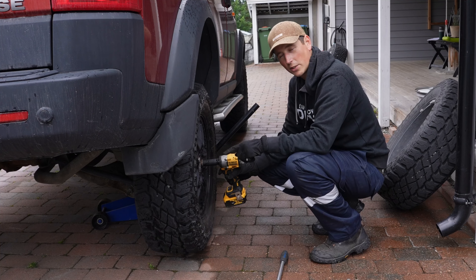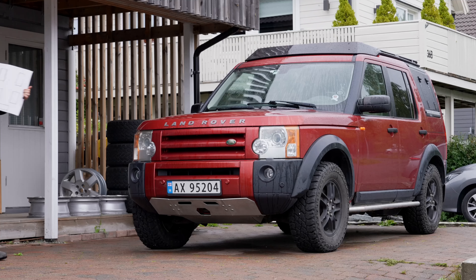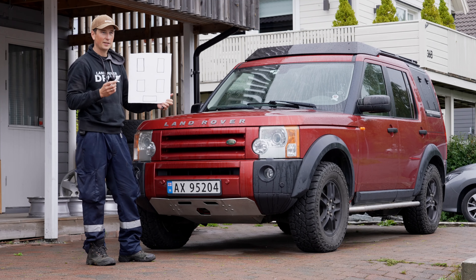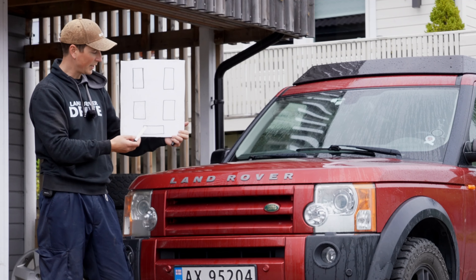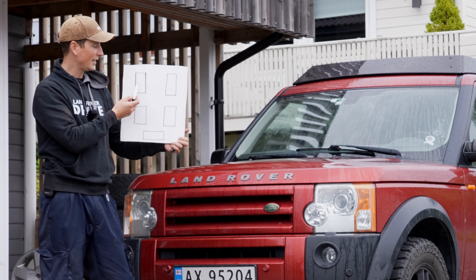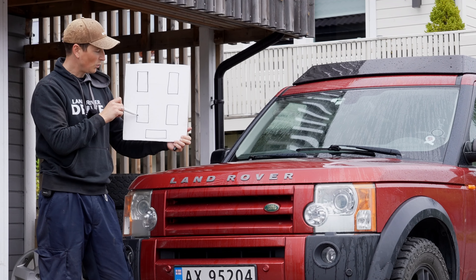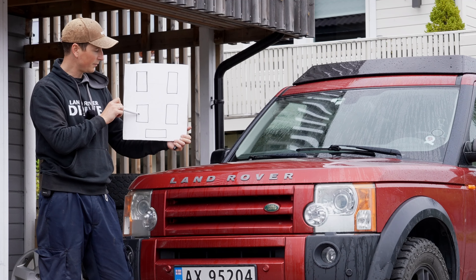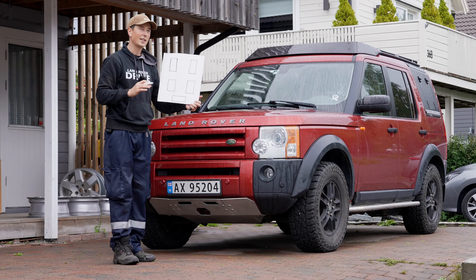Let's talk about how I'm going to rotate my tires from now on. For some reason, I had just been rotating the tires clockwise — after driving 5,000 km I took my spare, put it on the left rear, then left front, just keeping the circle going. What I noticed is that I got more stepping on the outer side, because you're putting the left tire on the front and it gets the same rotation direction. So I was thinking there should be a better way.